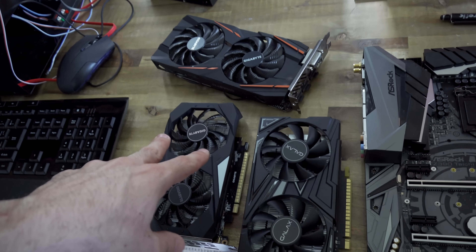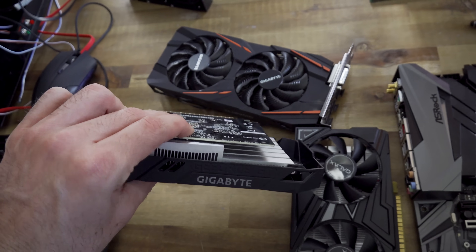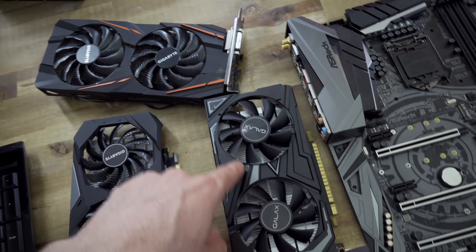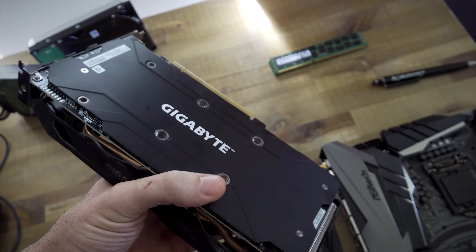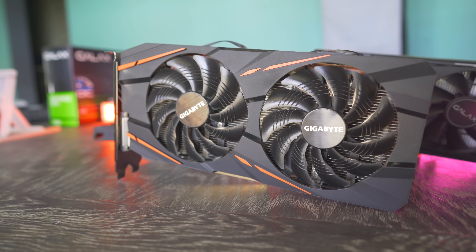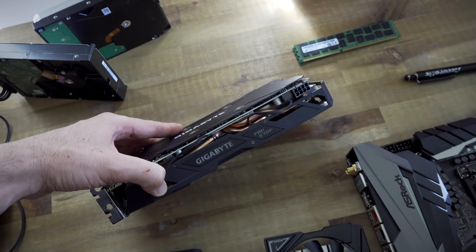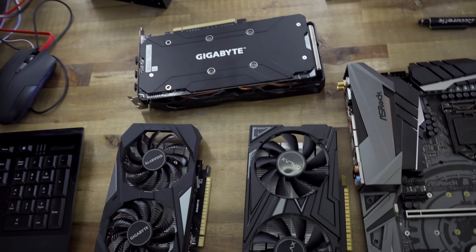What we've got now are three different cards: two GTX 1650s — one being the GALAX version, the other being the no PCIe 6-pin Gigabyte Edition. We're going to see which uses lower power compared to one another. Honestly, my bet is on the GALAX card because in the last year all the cards they've sent have been very power efficient. Then we've got the RX 570, which I picked up on a deal for 80 Aussie dollars — really good value for money. That's been the biggest detriment to the 1650 so far: the RX 570 exists and the price for it is really inexpensive. Let's put all three cards through this rig and see how much power they use for what performance numbers they give out.